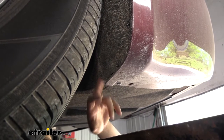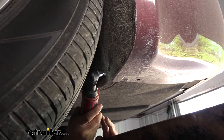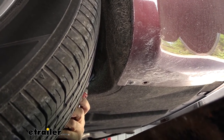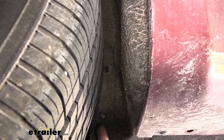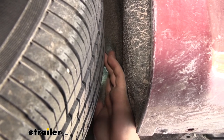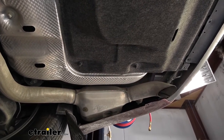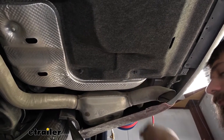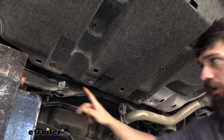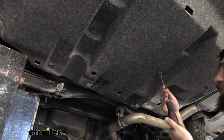If we come inside the driver wheel well at the rear, we have a few more screws hiding that we need to remove as well. Now that we have the bottom two out, we have one more at the top of the wheel well. There are also a couple more along the outside edge near the exhaust. Finally, we have two more fasteners — we'll take a large Phillips head screwdriver and just unscrew and loosen those, and we should be able to pop the panel down and out.